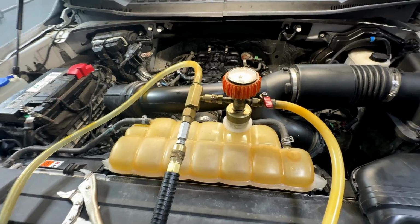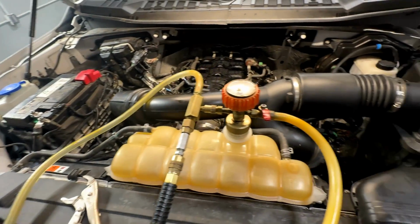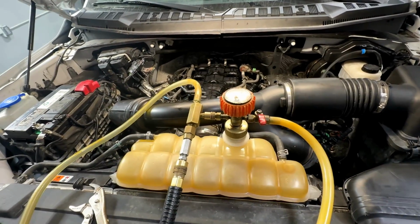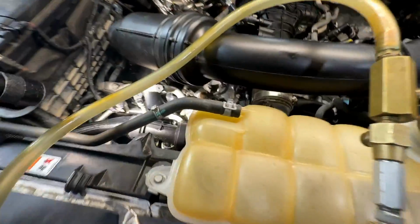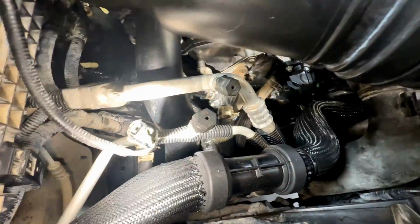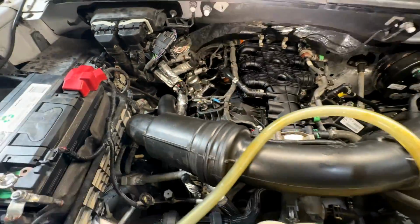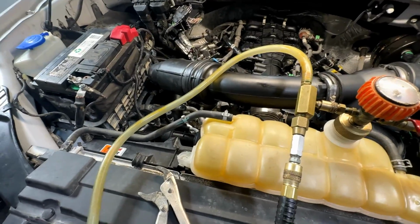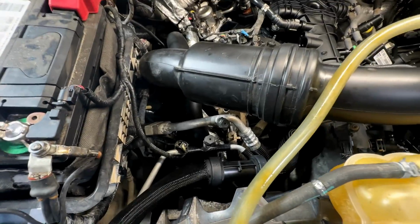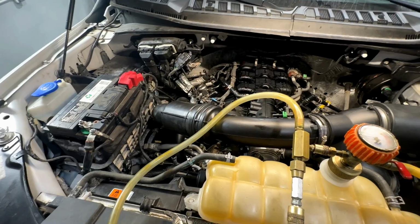And what this will do is it's like a pre-check to make sure we didn't miss any cooling connections anywhere, any hoses. I mean, on these newer vehicles, there's tons of hoses everywhere for the start-stop system, you know, and the heater hoses. And you just look in the front here at all the different hoses that are down inside of here. There's so many of them that you literally need to sit there and really plan out how you're going to route them and get them in there, because it's so clogged up in the front here, to make sure it all fits properly and nothing's rubbing on each other, stuff like that.